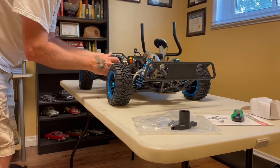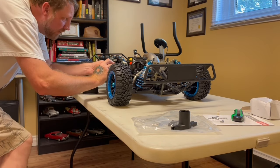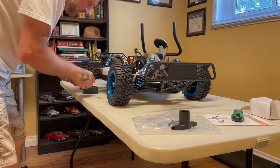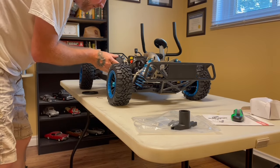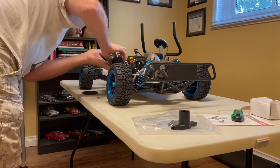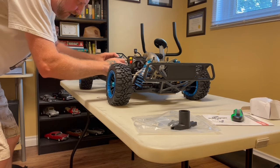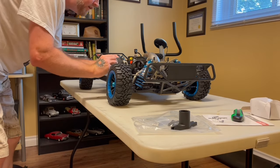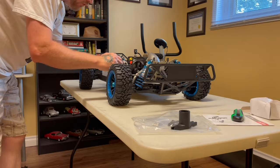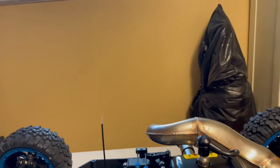Take your air filter out — it's definitely a good idea. Look in there and make sure there's nothing in the carburetor. It's got an internal filter that probably should be oiled, and then you've got your outside pre-filter. The carburetor has a marked high speed and low speed jet. If you're not familiar with tuning two-stroke motors it's really not that difficult once you get onto it.